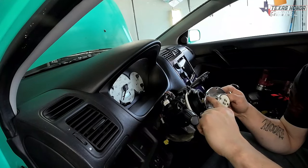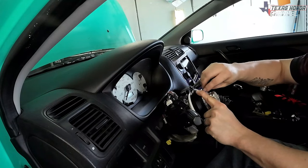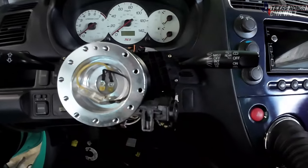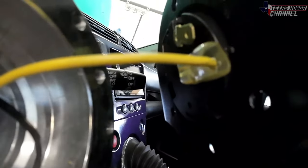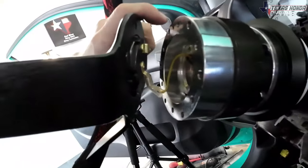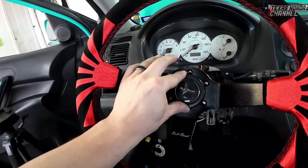With these NRG quick releases, there's actually a little dot right above the NRG logo — you're going to want that straight up. Next we're going to put this part on. You can see that little dot is facing straight up, so that's where we're going to align this. I connected that center wire there to the yellow one — the black one doesn't need to be hooked up. That little piece of metal will slide in at an angle. I hooked up the battery to test it and the horn works, so I'm going to get all this bolted together.